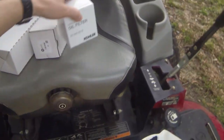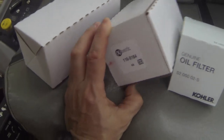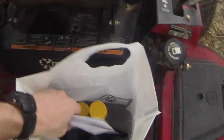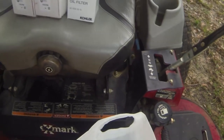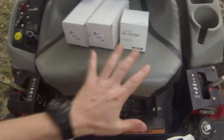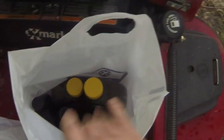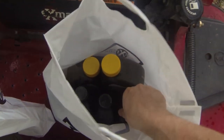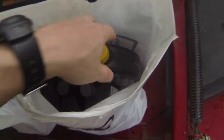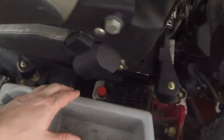As you can see, I've got some equipment here. This is our engine oil filter, and this is a genuine Kohler oil filter. These two are our hydraulic oil filters. All of this stuff came to $139 — very expensive to do this service, but it's worth it because this is a $12,000 lawnmower. I have premium hydro oil from Exmark — it's what it calls for, what they recommended to me. I have four quarts of that, which it holds two in each side.